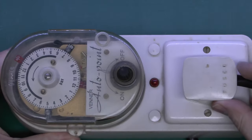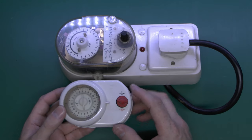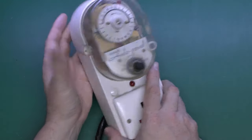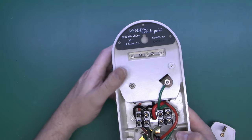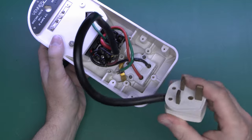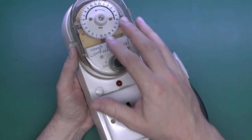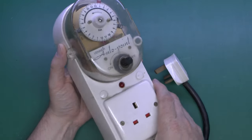Now the second item I've got here is this one. This is considerably bigger and has some other parts attached with it as well. If I look at the Venerette there, you can see it's considerably smaller - this is a considerably larger device, although it's based on a very similar principle. This is called the Auto Point, with the point referring to the outlet here at the bottom. This thing was of course intended to be screwed to a wall - you've got the keyhole slot at the top there, so you basically put a screw in the wall and just hang that over the top. Then you just bring the wiring in the back onto the terminal blocks here. Whoever the owner was actually fitted this rather doubtful flex in here, just sort of shoved the wires into the three terminals. Presumably they just have this plugged into the mains outlet, and then you set your time and plug in your appliance to the outlet here, and that will turn on and off at the times you've set. This is pretty much the equivalent of those plug-in timers you can buy now.